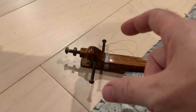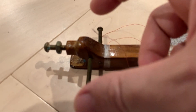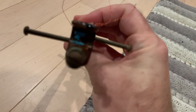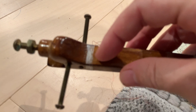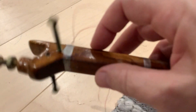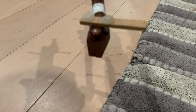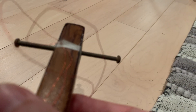But they do more than that. These are also brass screws, and if you screw them in more or out, you can alter the balance and make the arm tip a little bit more one way or the other. That's because this is a uni-pivot design — there's a dot there, that's where it sits on the uni-pivot point, and it can balance freely in any direction. You want it to sit perfectly level so that the horizontal tracking angle is aligned to the record surface. You can change the horizontal tracking by adjusting the screws.